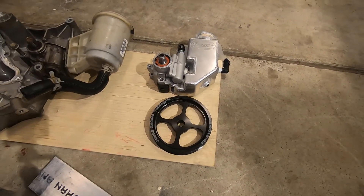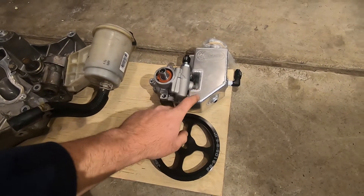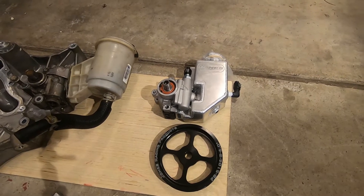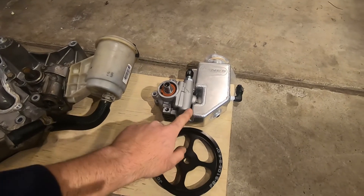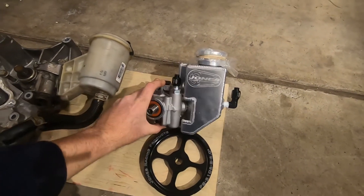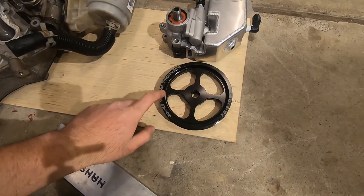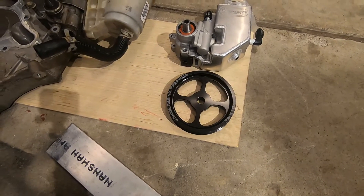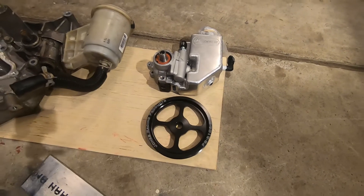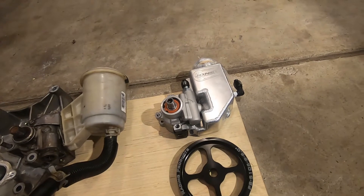Jones Performance Products was able to tell me exactly what the PSI output of their pumps are, the gallons per minute, and it's within spec of the Borgeson unit. The big reason why I delayed so long putting this video out was because I wasn't sure what Type 2 pump I wanted to go with. So many aftermarket pump manufacturers come with a plastic reservoir, and I didn't want to risk running a plastic reservoir and running into a crack or leaking issue later down the road. The Jones pump comes with a TIG welded integrated mount reservoir, which is really nice. It comes with all the fittings and a CNC machined cap with a rubber seal, so you're not going to get any leaks. They also offer their CNC machined front pulley — they recommended I go with a 6-inch pulley because the eventual ATI balancer is going to be just under 6-inch, and they want a 1-to-1 ratio up to 6,500 RPM. I got this from 90 Racing, a performance parts supplier based in Pittsburgh. They were a huge help — got it super fast, super affordable. Big thanks to Sharon there.